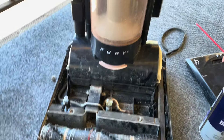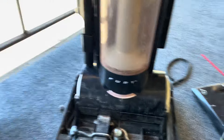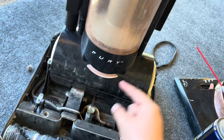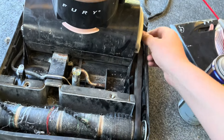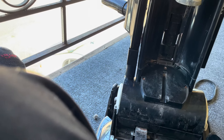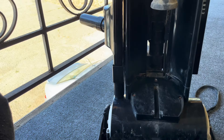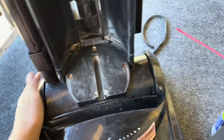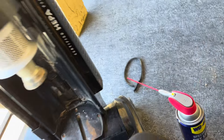Alright, I'm back. I went ahead and put the belt on that he provided, and I put a new headlight in this. But the motor is not spinning — it is locked up. I know this thing has some bearing problems. And this bin is extremely loose, so I've got to figure out what's going on with that. Obviously, this is not in good condition — it is clearly a very worn out example of a Phantom.